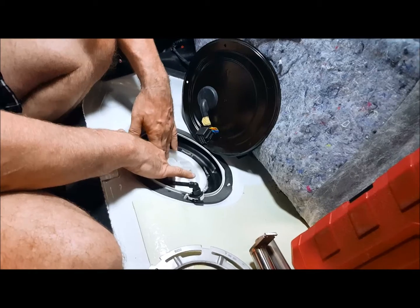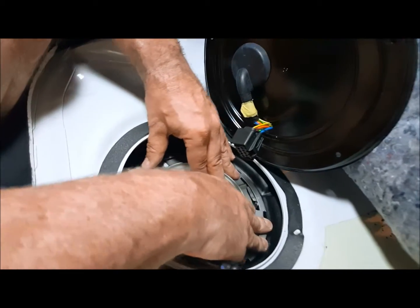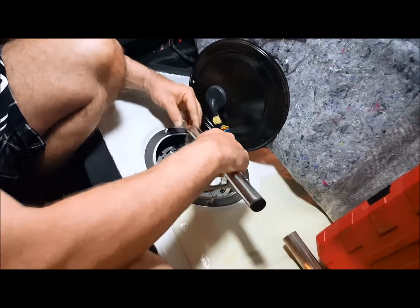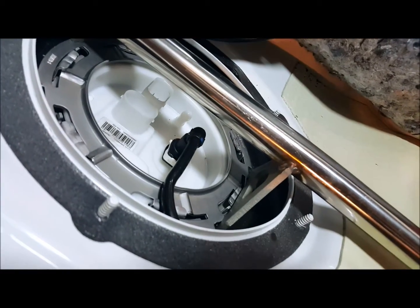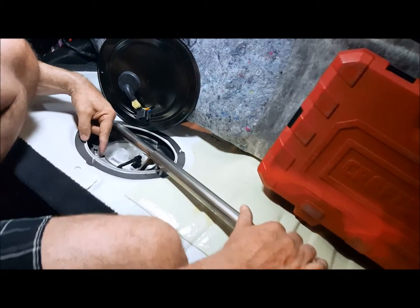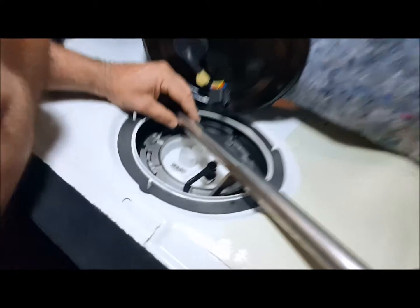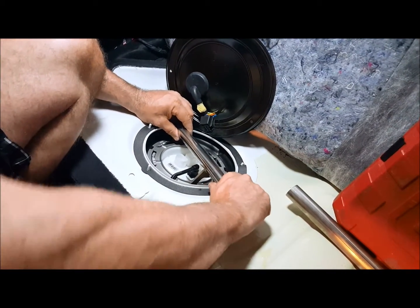Now that we've got our pump in place, we'll go ahead and take our lock ring and put that in place — just push it down and rotate it a little bit to hold it in place. Then go ahead and put your fuel line back on, push that on, lock it in place, push the little lock there. Grab our lock ring tool, slide the front on, and lock the back in place. Put the extension on and rotate it. You'll see that there's a ridge here — this ridge and this ridge need to line up. Complete the rotation and now we've locked it in place. Everything's lined up. Remove the extension and the lock ring tool.